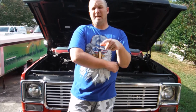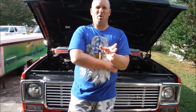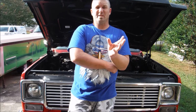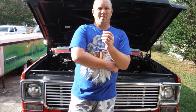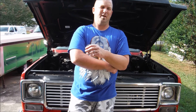Stay tuned, because in the next video, I'm going to be going over a lot of the little odds and ends that most people don't go over in these build videos. Things like where we're pulling our oil supply from, changing over the IAT sensor that's built into the MAF to a standalone sensor. That's something that's necessary on these LS engines when you're doing this. Also going to be going over doing the SD tune and converting that over. As a matter of fact, I'll be doing a separate video on that to put in my HP Tuner Tips and Tricks series. Stay tuned for that video.